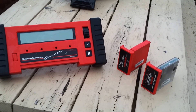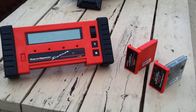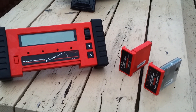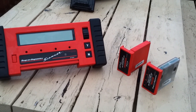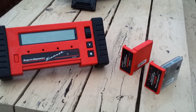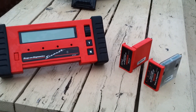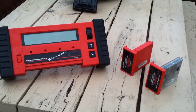What you're looking at is my Snap-on MT2500 — old device, new to me — and it's going to work just fine because I have a 1990 Jeep Cherokee with the RENIX configuration. Those in the know know that that is a pre-OBD1 scanner interface, so this MT2500 has the capability of reading the computer in my Jeep. That's why I bought it.